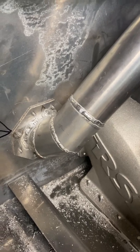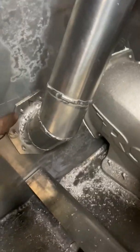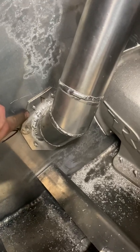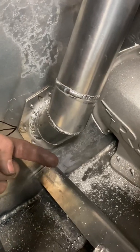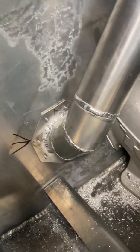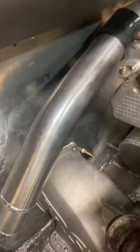It kind of looks like a stovepipe a little bit, but I just welded an eighth-inch flange and I threaded it quarter-20 threads. So this thing's going to all get sealed up, and then I can put a small nut on the back sides of those. So this all worked out good.